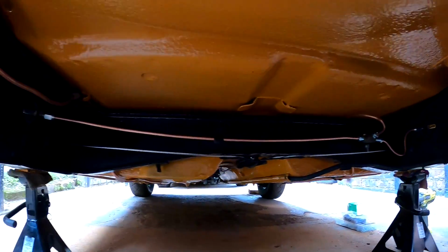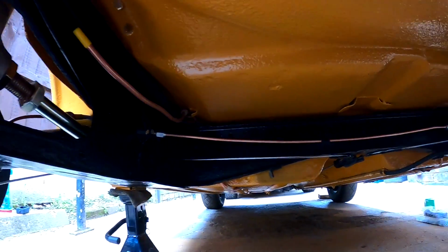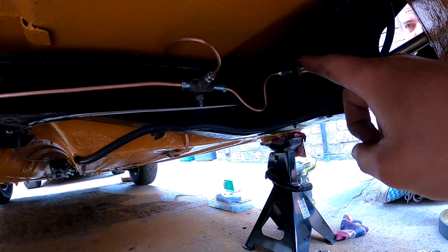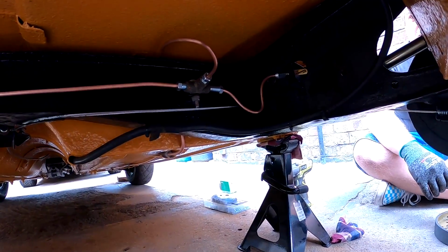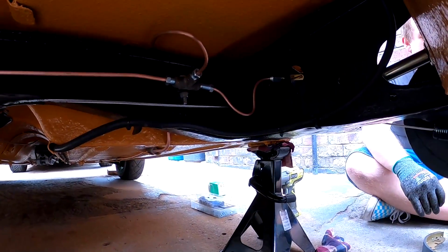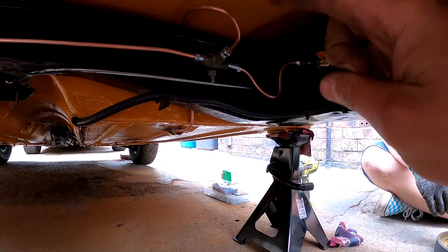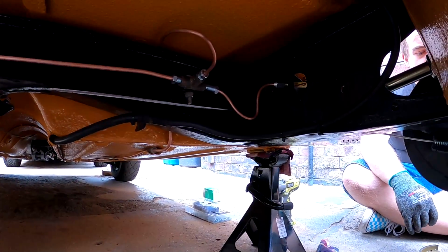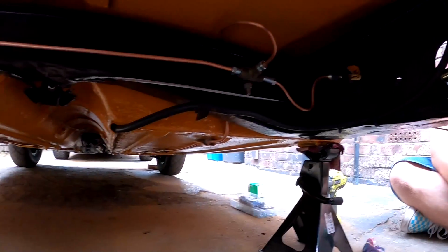So inside the car, we're all connected up. Obviously that's the fuel line there, it's not gone into the car yet, but we've got all new copper lines, and that was one we were talking about. Originally it was a similar shape to that, but a bit shorter than the original one, but there's no kinks in that and it'll work. We've just looked at some pictures on Google as well, and I've noticed the early Cooper S's and stuff that had the compensator at the back, it's all coiled up in the corner, which just looks a bit of a mess. So that looks a lot tidier than what we've done there, but James managed to do that because I was losing my temper with it.